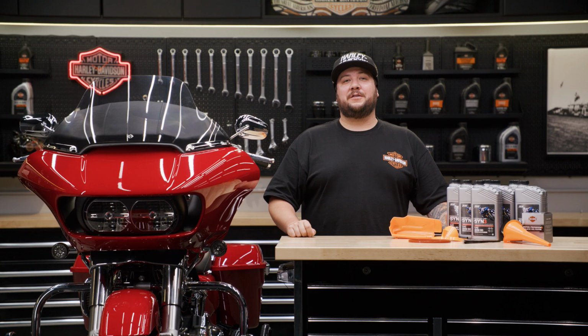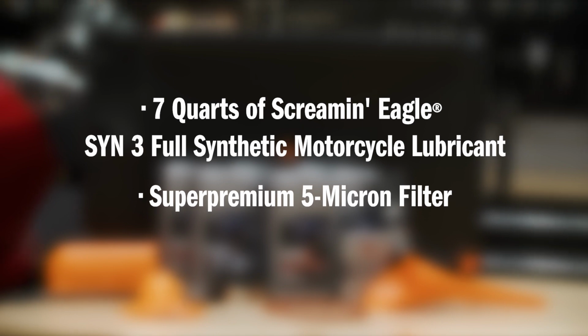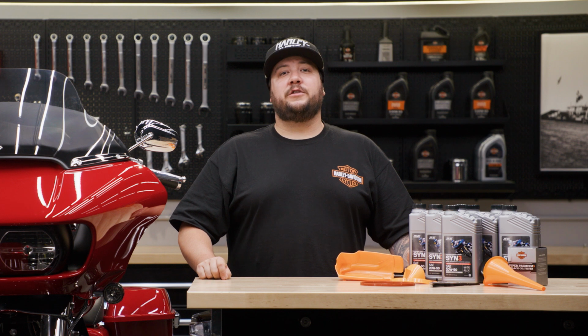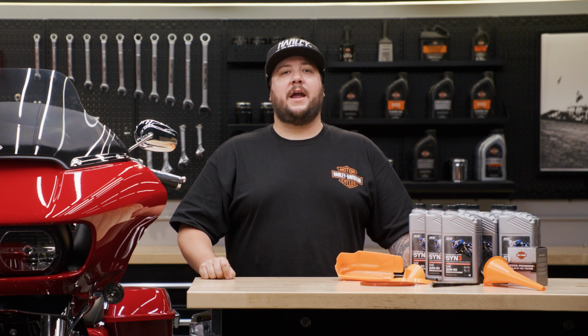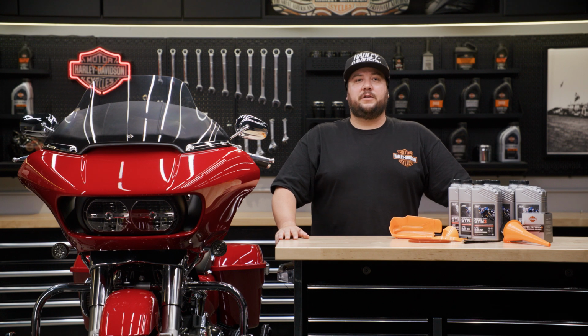As for replacement parts, you'll need 7 quarts of Screamin Syn 3 full synthetic motorcycle lubricant, a super premium 5-micron filter, and a service gasket kit. Alternatively, you can get a tune-up kit that includes everything you need in one convenient box. All available at your local dealer or h-d.com. It'll take the average person about 30 minutes to do this job.